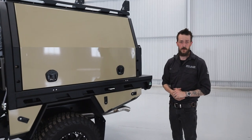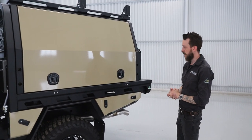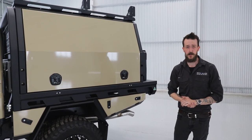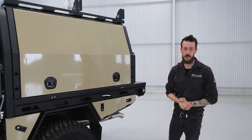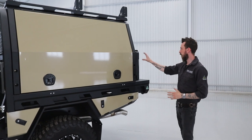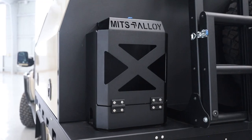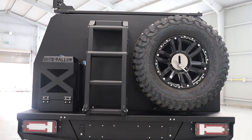Moving on to the canopy on this Land Cruiser, the size is 1700mm long. That's technically the full size we'd put on a standard dual cab, which we don't recommend due to the rear overhang behind the axle. In this case however, because we've added 300mm, it lets your rear wall accessories like your jerry can, ladder and spare wheel sit essentially on top of the tray, therefore closer to the rear axle.